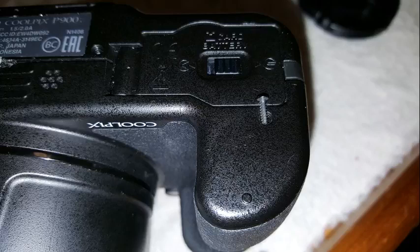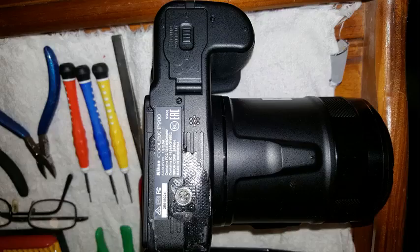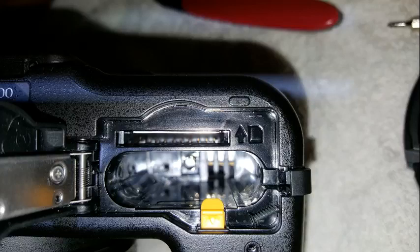Remove the battery. Remove the screws holding on the back. Extract two screws on the back side of the camera mount hole — do not remove all four. Expel one screw on the right side of the bottom beside the battery flap. Don't remove the screw inside the battery compartment. Take out two screws on the left side. Extract two screws on the right side, one under the flap.